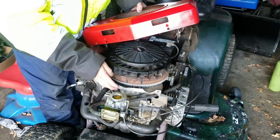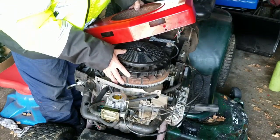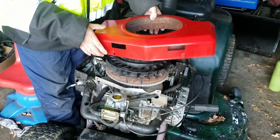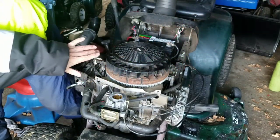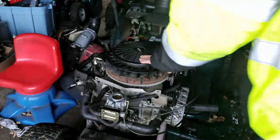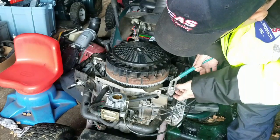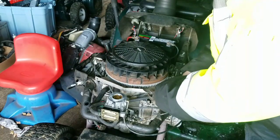I have a feeling that when I was repairing this engine, or rebuilding it, if you will, it didn't have the flywheel on here. Therefore, it was resting on this metal tin. So I'm thinking maybe the tin was pushed down. So I have to try to use my channel locks and kind of bend it like Beckham. But look, if you look at the teeth, we're talking about a millimeter away from it, so I don't know how much I can bend upwards to give it the clearance.